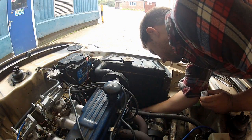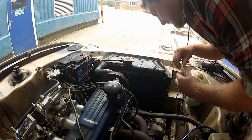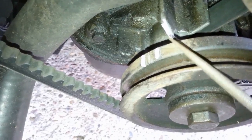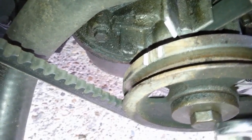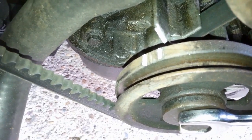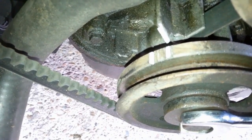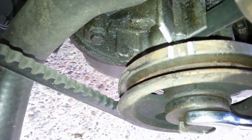I do love my Tipex — I don't think there's a component in this engine bay that hasn't got Tipex on it. Now that I've marked these up, you'll notice they stand out a lot more clearly, and I've also marked this pointer here — this is your reference point. If I turn the engine over by hand in the direction it rotates when it's running, as this first mark comes round and lines up there, I know that the piston in cylinder number 1 is 10 degrees before top dead centre. If I continue to rotate through, I know that piston number 1 is at the top of its stroke.